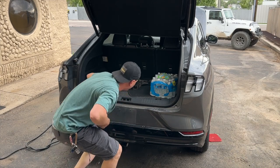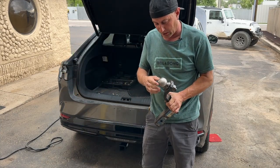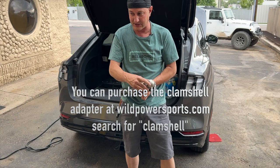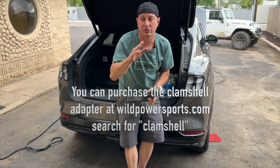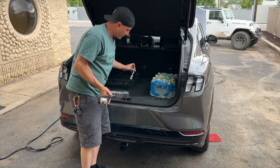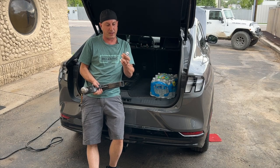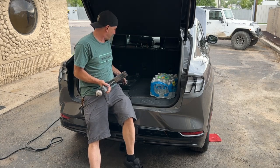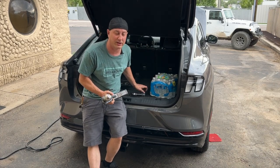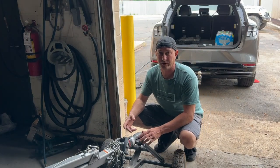I could get the key and lock that on, but I'm not going to do that right now. I've got my ball mount, which is cool — I actually have a two-inch ball in here with a Weigh Safe clamshell adapter to make it two and five-sixteenths, because all of my trailers are two and five-sixteenths. I gave up having to change balls all the time. The Draw-Tite kit gives you this really neat anti-rattle pin and even a little wrench to tighten it up. I'm going to put this in and hitch it up.